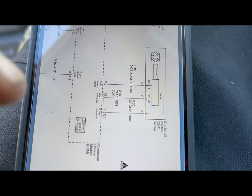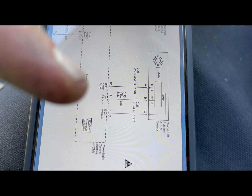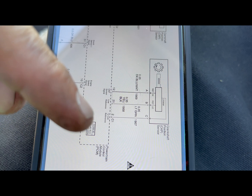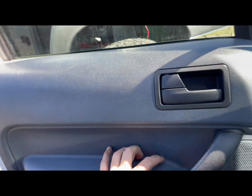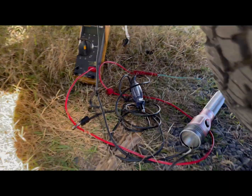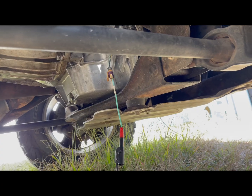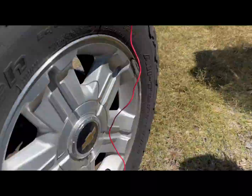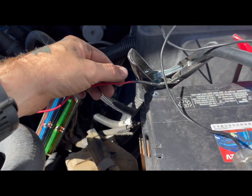This yellow-black wire — I'm going to go from pin B on the crank sensor to pin 21 on connector C1 on the powertrain control module. I'm connected into the middle pin, the yellow-black wire, with a jumper wire, and that jumper wire is connected to the battery.